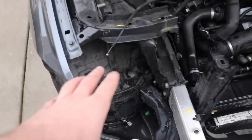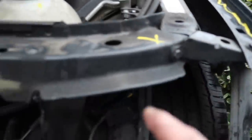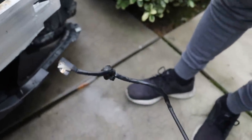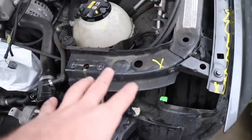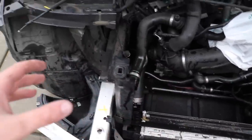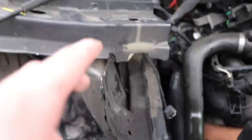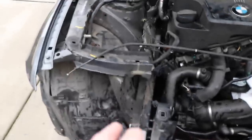So that is that. We ended up removing the headlight support, the headlight, radiator, condenser, and unplugged all the hoses. We're going to bag off the intake right now since the intake is removed. We removed the radiator support and everything on this side too. We were worried about what the X meant, but nothing looks bent and nothing looks out of place on this side. Something we did notice is that a wire on this side was cut. Luckily it disconnects from another location very close to it, so we just have to figure out what that wire is — a little bit of research will sort that out. It's also missing the hood latch on both sides, which is strange. There's a subframe here that's a little bit bent, but it has a bolt and a couple of welds — I'm sure we can un-weld it if we can't get it straightened out, but it should straighten out fine at a shop.